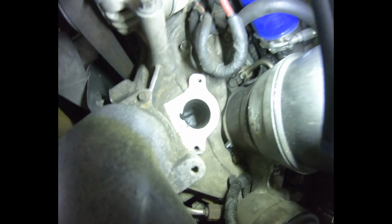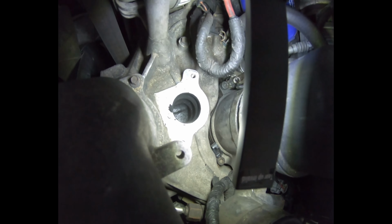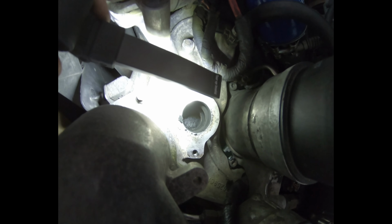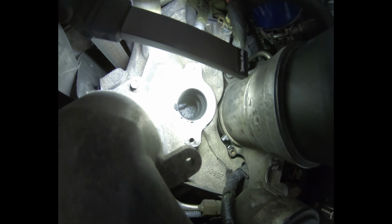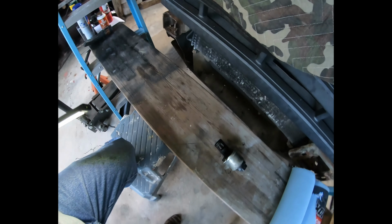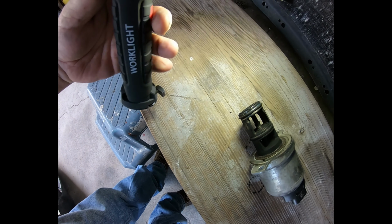And in the cavity, well, there's a bit of gunge, but it's not massive. So I think we'll just do a bit of a normal cleanup here. Make sure it's operating correctly and that the piston is moving smoothly. And then we'll get it back in with new gaskets.